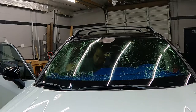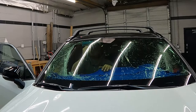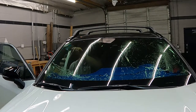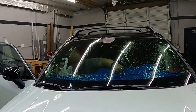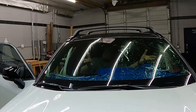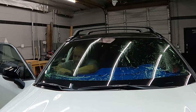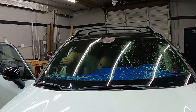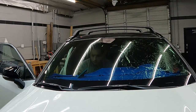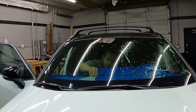While doing windshields I go little by little as I squeegee, working the film across — that's just how I do it. I know you can do big strokes and that's fine too, I'm just comfortable with little strokes. Make sure any air that builds up isn't coming back into your squeegee line. Also make sure you have the right tools because some bottom corners on back windows and windshields need special tools — watch a bunch of videos before you go for it on window tinting.